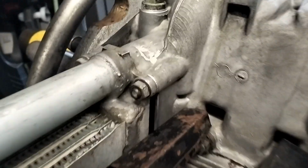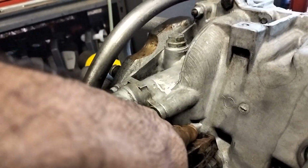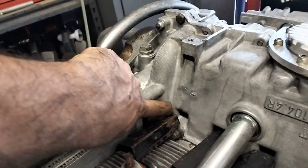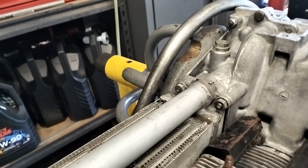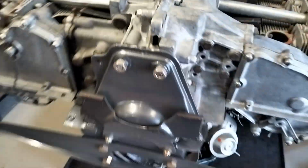One thing I noticed on this one is that they didn't actually fill in that little void with some metal epoxy, so I'll probably have to pull the oil cooler off and do the void on the inside as well. Of note, it wasn't leaking, but there's no point not doing it while I'm so close. It's just another 4 nuts to get the oil cooler off and replace some seals, and yeah, just epoxy it up. So that's where I'm at the moment.